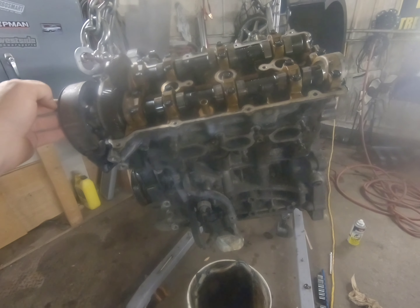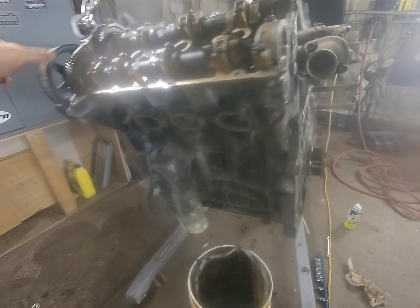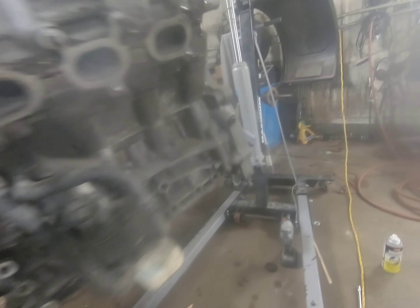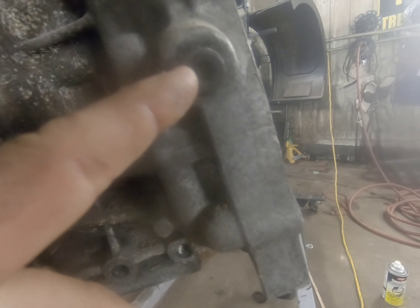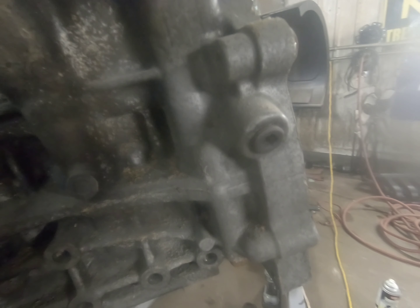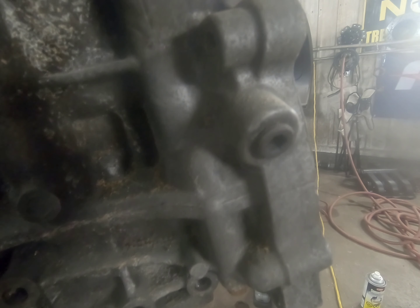I'm also looking for a spot to get oil for my turbo, and I found it right here. I need to take this allen out and then my adapter for my turbo oil feed can go in there. Pretty much all I'm doing to the engine is resealing the valve covers, doing an oil bung for the oil pan and the turbo feed line, repainting it, and getting everything figured out for the turbo setup.